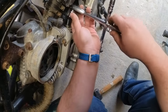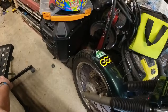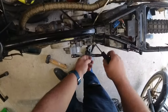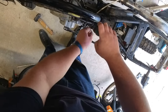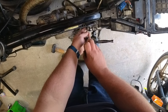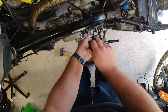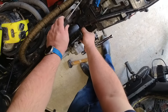The next part - the workshop manual says to remove the cap and then loosen the tensioner. I think actually what you need to do is take the entire thing out. It has inside it a spring and a plunger that are not constrained, with two washers on them. If you leave it in, when you take the cam chain out it releases tension and the plunger shoots forward and drops into the engine. Mind you, if I'd taken it all the way out there wouldn't have been sufficient tension on the cam chain to keep everything together while drawing it out. I'm not even entirely sure my bike had the washers on that assembly in the first place.